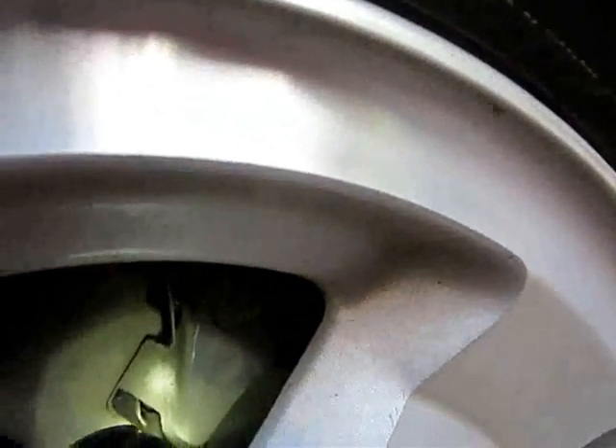is sunken down pretty good on this particular vehicle. When the brake pads are new, that ear on the brake pad is going to be pretty much all the way out, almost to the very end, or even with the caliper bracket — which is this piece that I have the three lights on. So when I look at this, it's getting down there pretty low. You can kind of see how much pad life you have, which isn't really much.